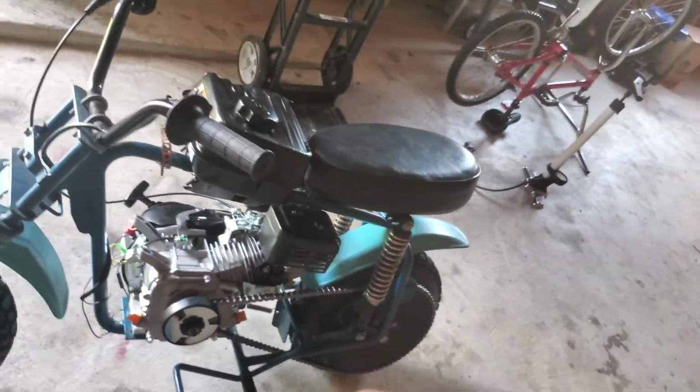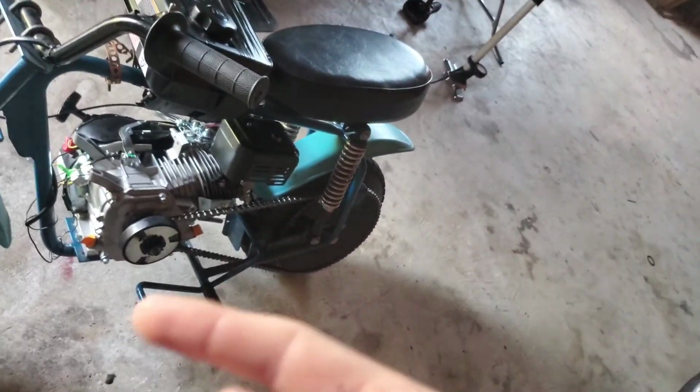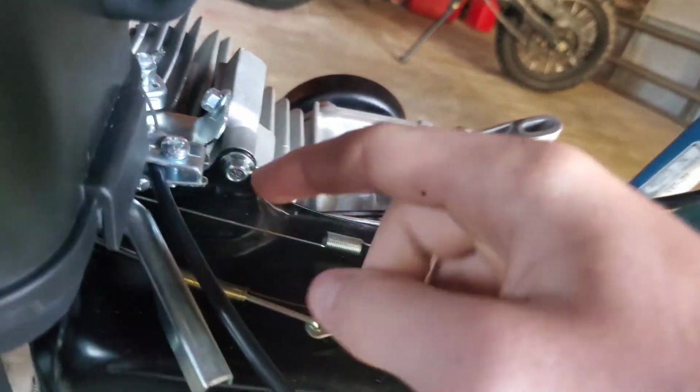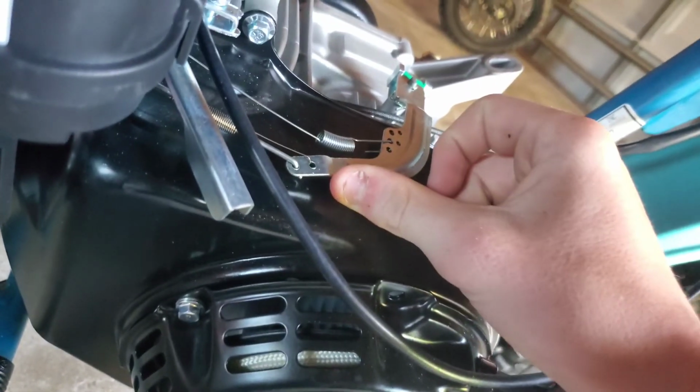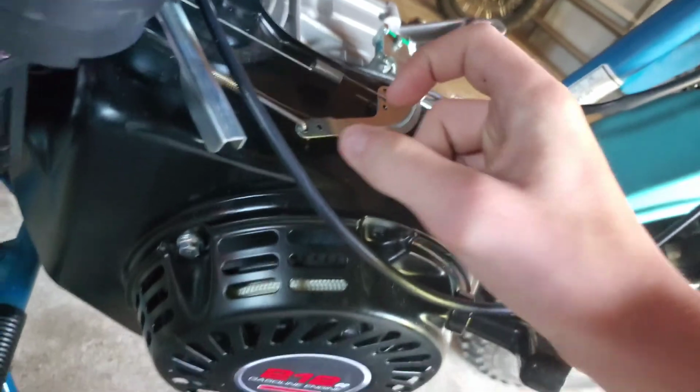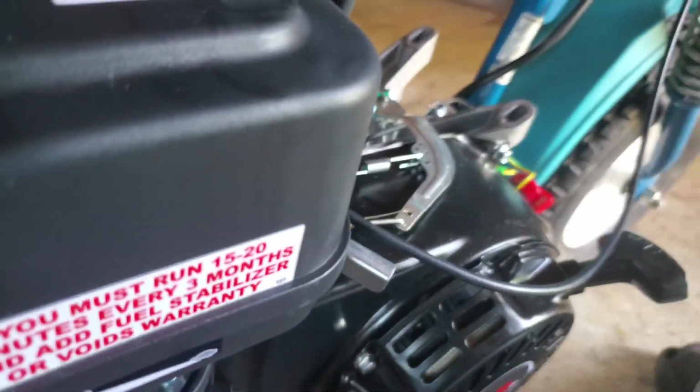However, in my next video or so, once I get this all broken in even more, I'm going to show you guys how to bypass the governor on the other side to get more speed. All you really do is get tension on this to this bar here up in the harness so that it keeps this pulled back the whole time, because the governor usually likes to sit there and bounce. That's what it does whenever it limits your speed.